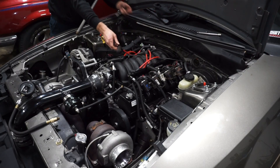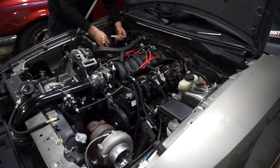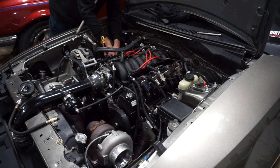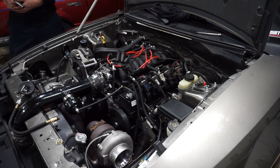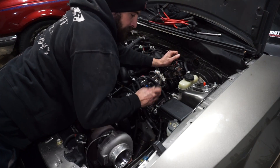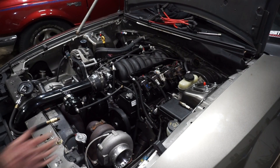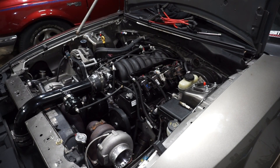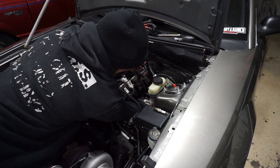Checking the passenger side — that plug wire just fell right off. That one's tight. Put the tester on it — it's really tight in there, especially when it's hot. What I'll do is open the throttle blade with the pedal and then crank it over, probably counting the number of revolutions so I do it the same on every cylinder.